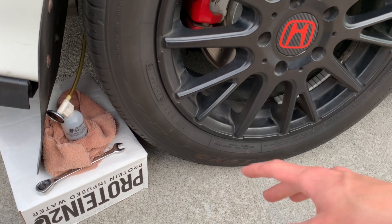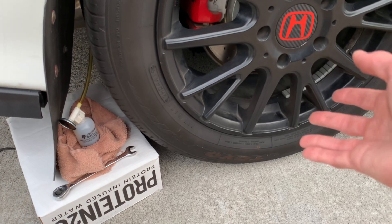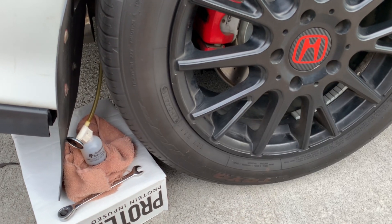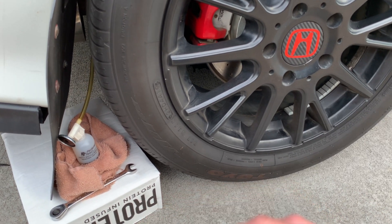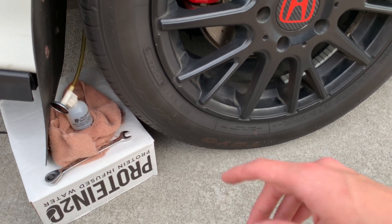The reason I'm bleeding the air out is because I replaced some of the brake lines with stainless steel lines, so that's an example of why there's air in the system. Another reason would be if the reservoir ran too low and sucked in some air, or in more severe cases your system might have an air leak if it's ruptured anywhere, so you want to make sure that's definitely not an issue.